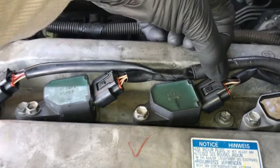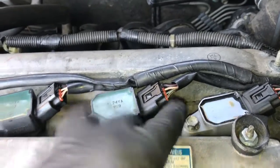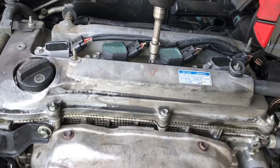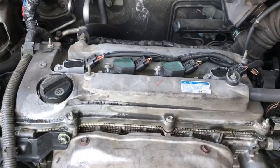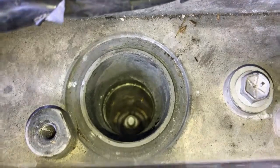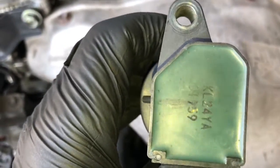One of the first steps is to do visual inspections of all the plug connectors. I like to check and make sure they're not loose, and also check that the wires have not backed out of the plugs itself. Next, I'll unbolt the coil that I suspect is giving us the problem, pull it out and give it a good inspection. I'll also look into the ports where the spark plugs go into and check that the valve cover is not leaking oil into the tube seals.